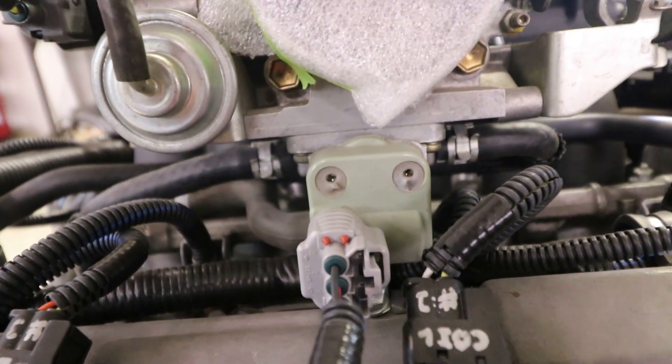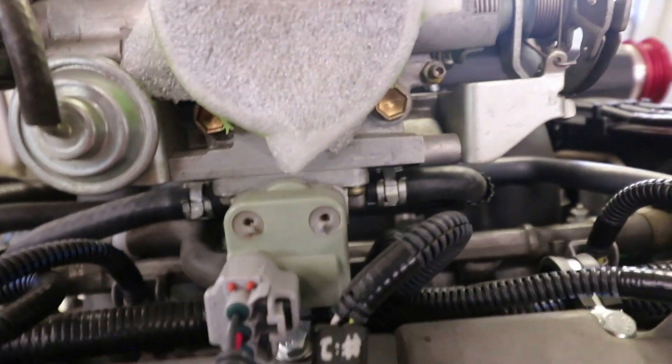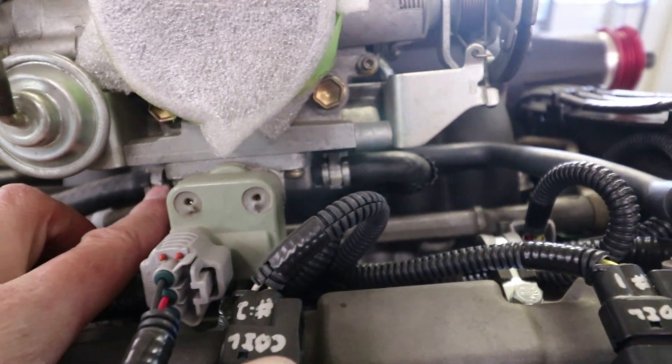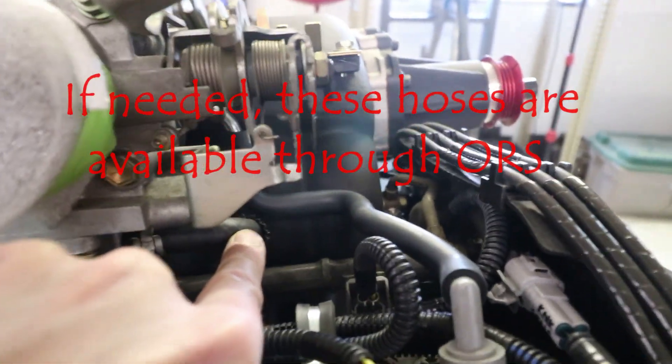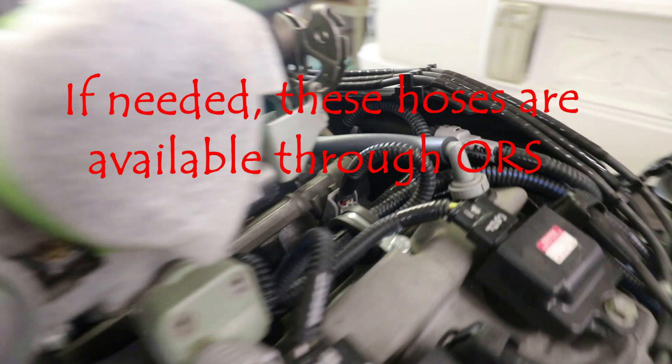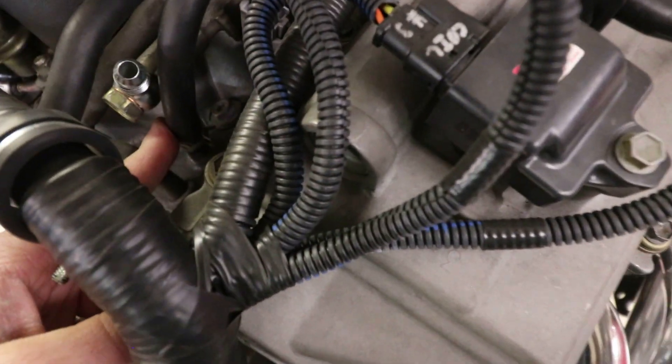Before installing the 3.4 liter 5VZ, it's also very good to have the coolant hoses underneath the throttle body fully connected and clamped down. Facing the front of the throttle body looking into it, on the bottom you see one hose connecting to a hard pipe and another hose connecting to a hard pipe — this hose has a U-shape to it and passes back under the throttle body. The other hose comes outside the throttle body and is actually a straight piece of hose bent just a little, coming down to a hard pipe coming off the back of the intake manifold.